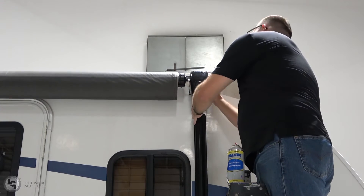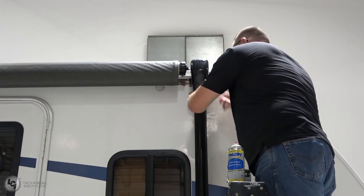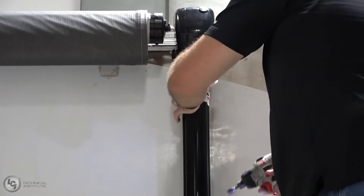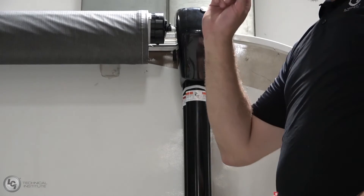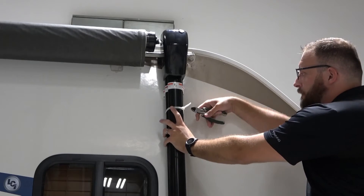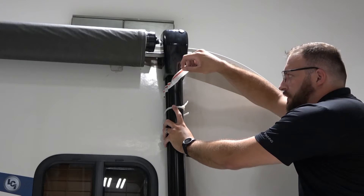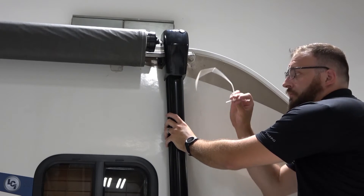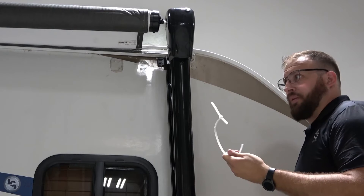If we need this to spread out a little bit, we can do that. Once I get it up here, I've got two assistants helping me hold it in place. I'm going to attach my first screw. Once that first screw is in position, I can adjust or shift this as needed. We'll go ahead and secure the opposing side and get that fastened. Now we're going to go ahead and cut our zip ties and remove the safety tape — the safety tape is just to let you know there are some pinch factors to watch out for during installation and also operation. The zip tie is actually behind your mount arm, so that's why we didn't want to fasten all these screws down just yet; otherwise we wouldn't be able to pull that zip tie out of the way.